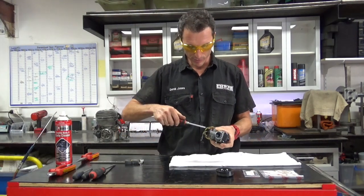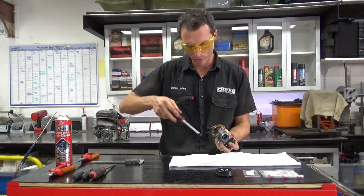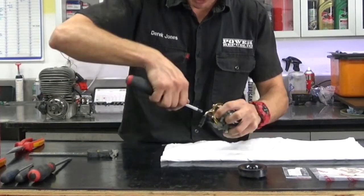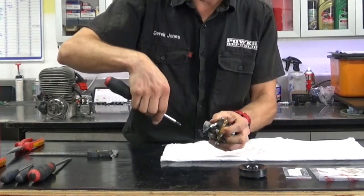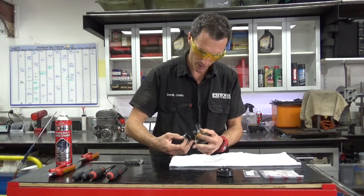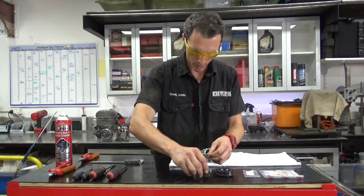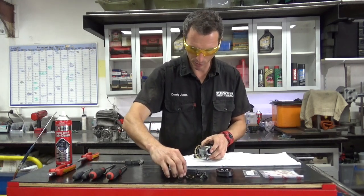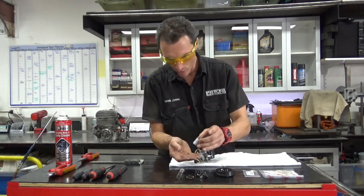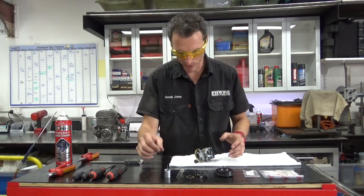The first part of the operation — well, this is how I do it anyway — grab your Phillips head screwdriver and remove the two screws on the top of the carburetor. Now this little guy in here is spring loaded and it will pop out, so just hold it down with your fingers. Use your screwdriver. There's a little gasket there — I'm going to put a new one in. Lay those parts out as you go, keep it all neat so you remember which way it goes back. Slide out the throttle slide; careful, the needle will just pop down and you can lose it, so hold it gently because they bend easy.